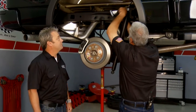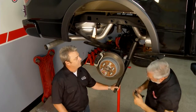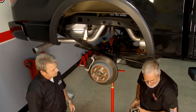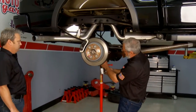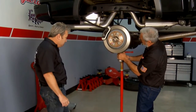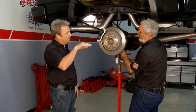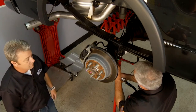With the bolt out, we use the impact gun to pull the nuts off the U-bolts. We're taking the stock spacer out — looks like about an inch — and we're installing a two-inch block to replace the one-inch block. All Tough Country suspension systems are designed to level the truck, so by the time you put the front and back on, it'll sit level without the drooping front end that comes from the factory.